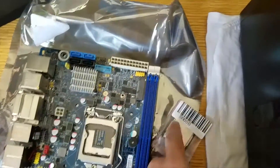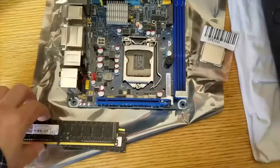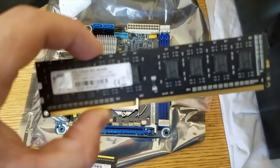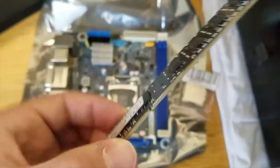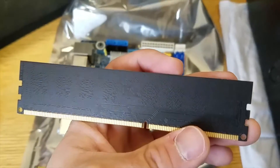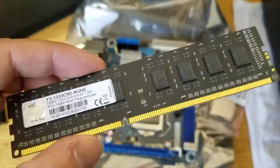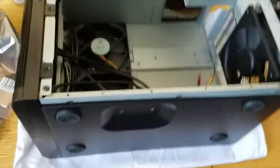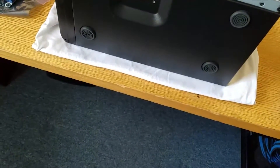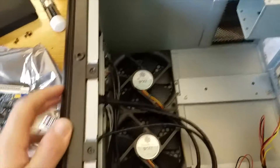That chip's got more than enough power for what I'm going to be doing. I've got 8 gigs of G.Skill RAM — just 1333 MHz value RAM. The cool thing is memory must be so cheap nowadays because there are no chips on the back — this is a 4 gig DIMM so these chips are pretty dense for value RAM. I also got the Silverstone DS380, a mini-ITX NAS case with this front door that reveals eight hot swap bays.